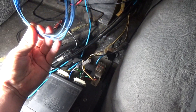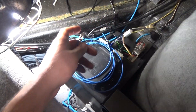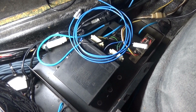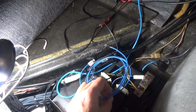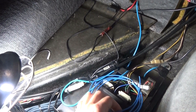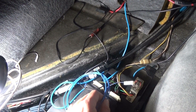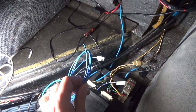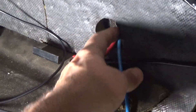Dave has supplied some wire for that with a connector that you will connect right here. There are a couple different connection points to work with. I contacted Dave, and he originally recommended connecting the wire to the pink wire coming from the compressor into the relay compartment. The other option is to wire it directly to the compressor, which is what I'm going to do — because I do a lot of AC work on the car, and when I'm diagnosing the compressor I'll jumper it to a 12-volt source, so I still want to get that 100 RPM bump. I've decided to just wire it directly to the compressor and go through this little access point right here.